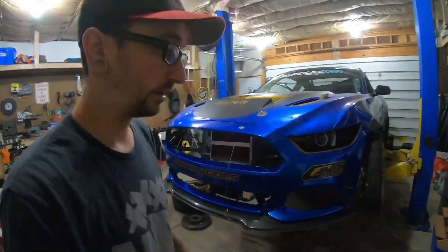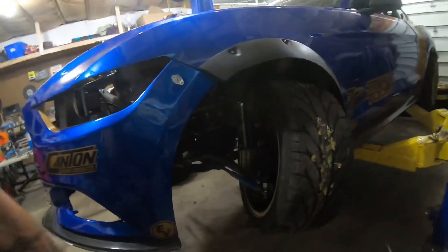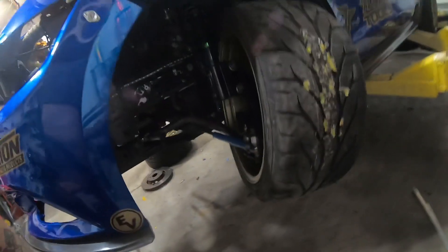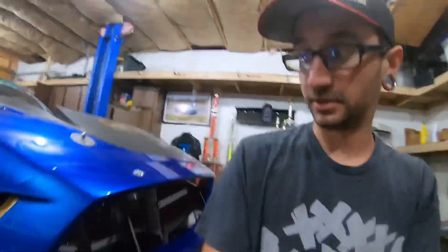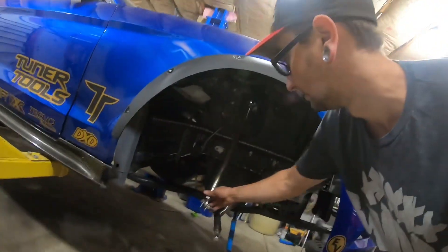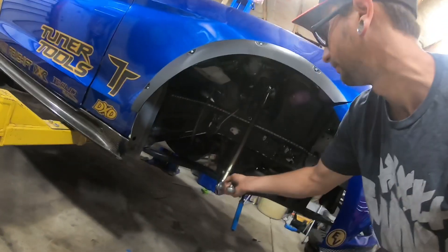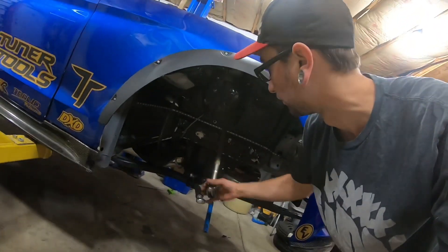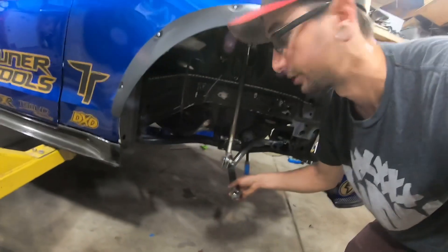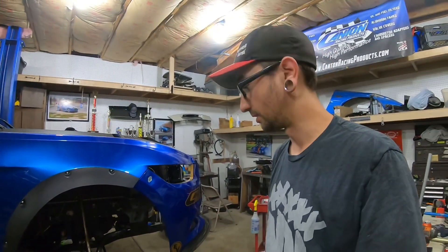It's the end of the day — I went ahead and built the other control arm. It fits pretty good, nice and tight, plenty of clearance, full travel. This arm has way more travel than it did before, so much smoother, no binding, and built a hell of a lot stronger. That should work great.